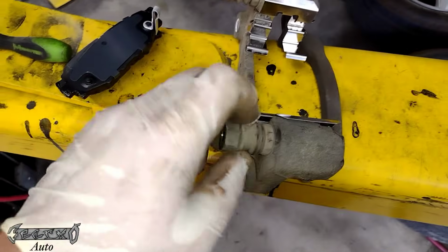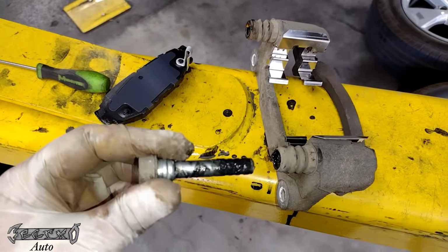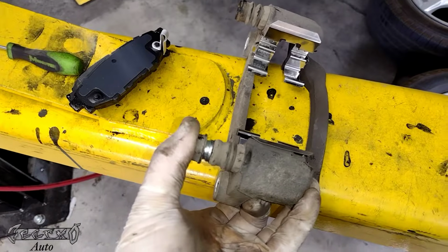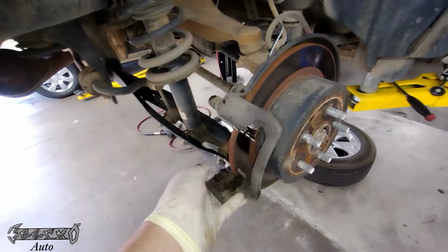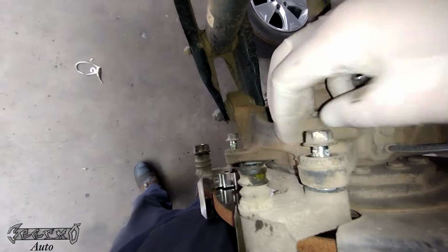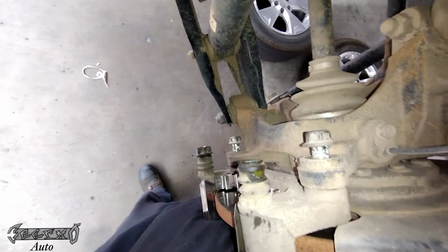Also, lube these slide pins. The bottom one will have a black grommet on it. Right here, that's the bottom one. I just put just a tad bit of lube on these. You don't want to put too much because then the pins won't go in. All right, so then once you got your new stuff on, we're gonna put this bracket back on. Put your 14mm bracket bolts in. Torque specs will be in the description.